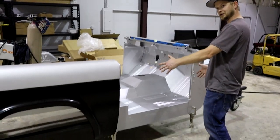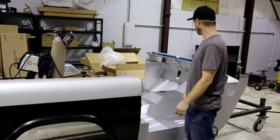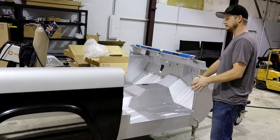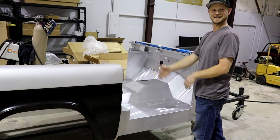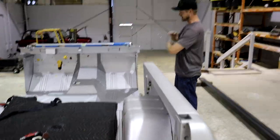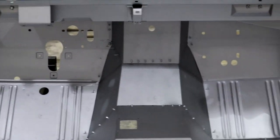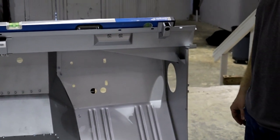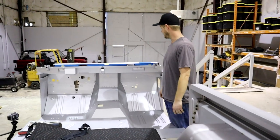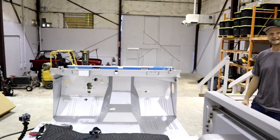At that point we'll start fitting the doors. So hopefully tomorrow — our plan is going to be getting that rear quarter done, getting these doors fit so we can get the A-pillar tacked into place. We need to do the tailgate as well. The firewall still has zero welds — just tack screwed in just to make sure everything aligns just right. But tomorrow: get the other quarter, get the doors, get the tailgate, and it'll start looking like a real Bronco at that point. Alright guys, have a good night and we'll see you in the morning.